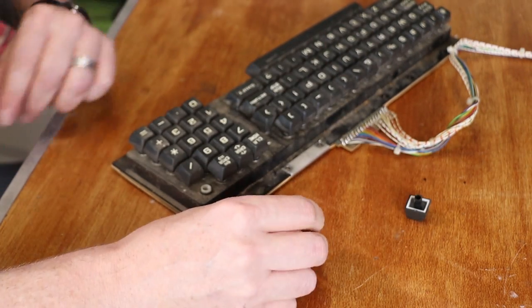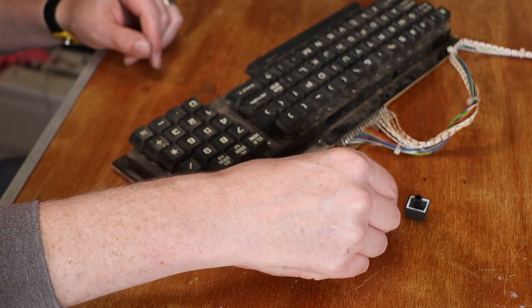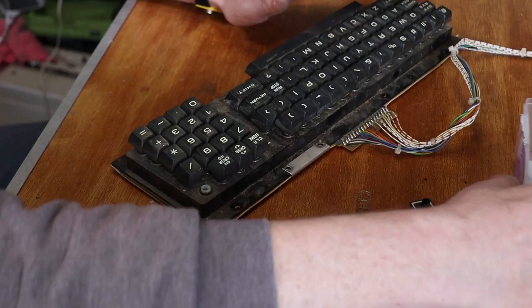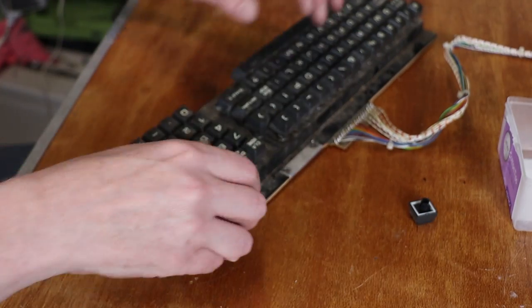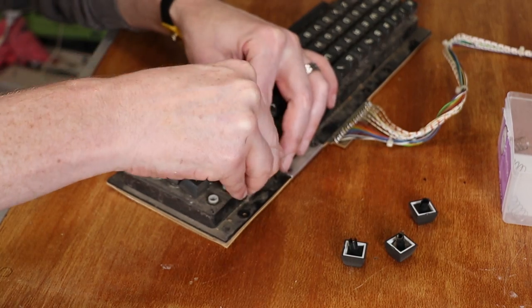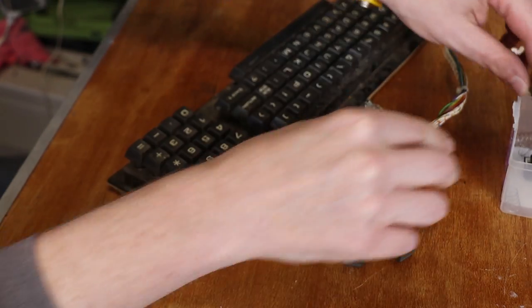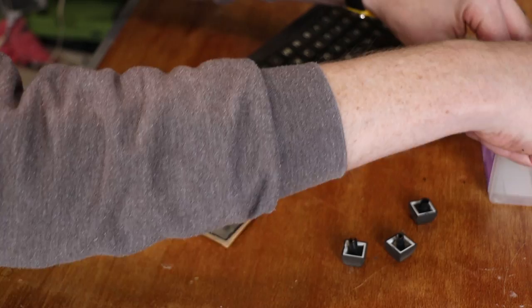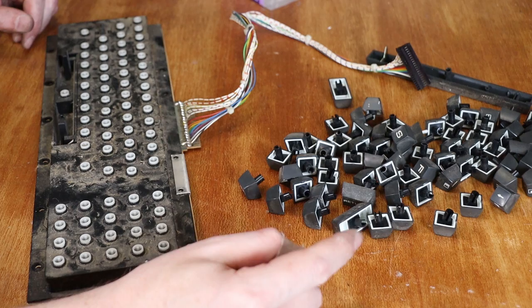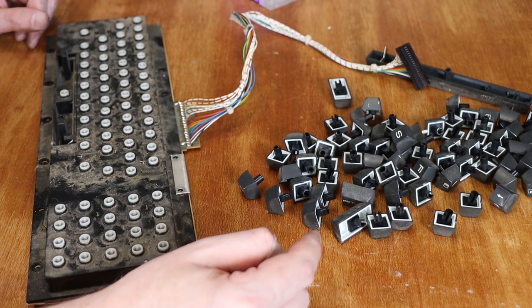What I am going to do is basically go straight to repainting all the little carbon pads on the bottom of the plungers of the keyswitches. But first, we need to pull this apart. I've misplaced my keycap puller - I cannot find it anywhere - so I'm going to have to attempt to do this the hard way and pray I don't break any key stems. We have springs - I should have seen that coming. Container to put springs in so I don't lose them. By some absolute miracle, I didn't break a single key stem.